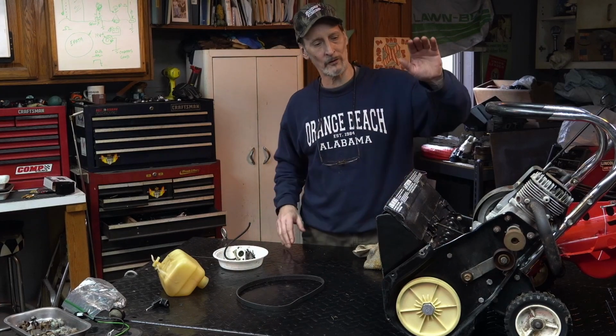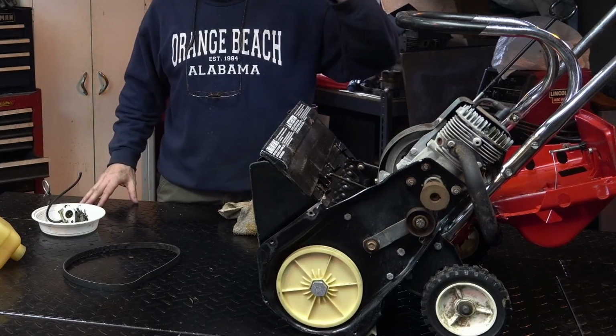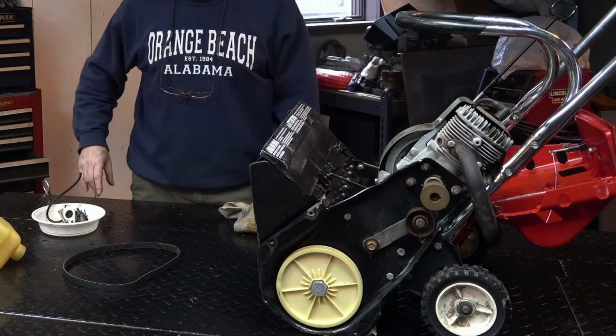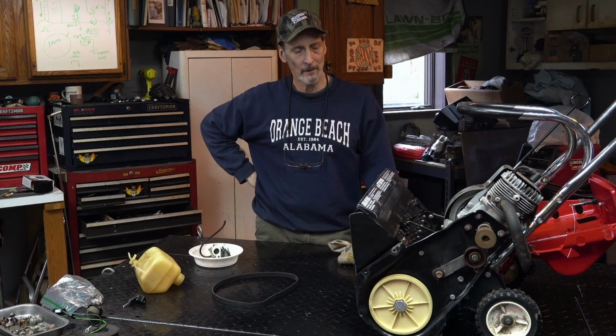Problem is, electric start sits right here, and all the water and, well, if there's salt, right, it sits on it. Most of the ones I've ever seen, save maybe one or two, those motors are just seized up. Electric motors, the Bendix seizes up.